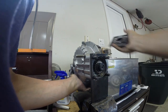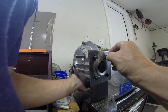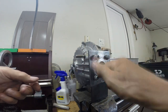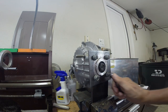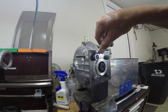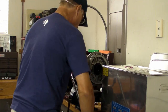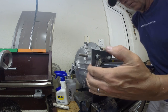This is where I use a little fixture I made from an old drive shaft — you cut it off, weld it on a plate, and it holds everything solid. If you don't want to make one, Boxer Two Valve actually sells them too, also made from old drive shafts. And here I'm tightening it — you've really got to crank on this thing. This is a big Snap-on half-inch torque wrench that goes up to 180 pounds; I think this is set to 135.